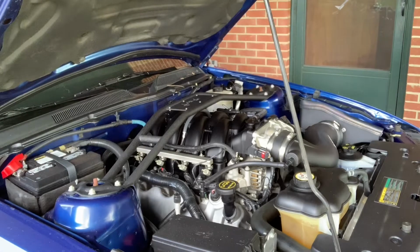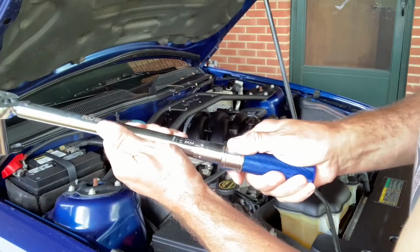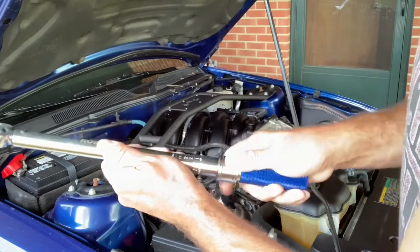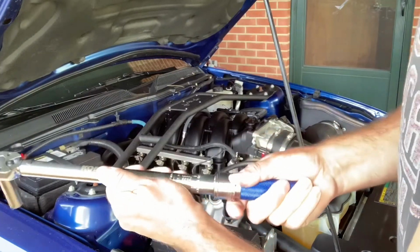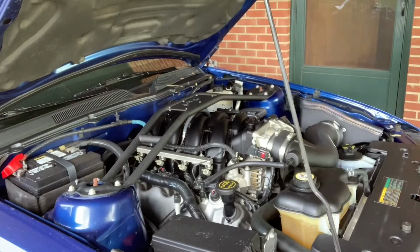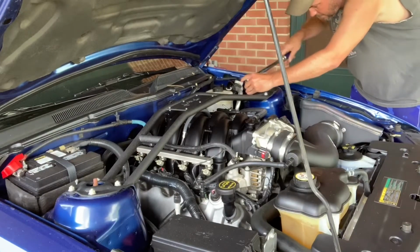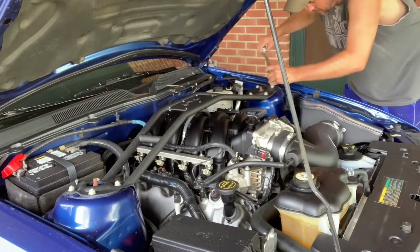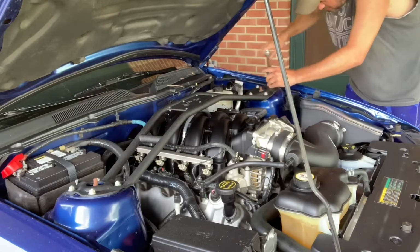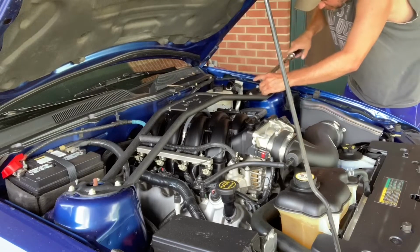So it does start at 20 foot-pounds. So you just pull this dial down. There's 21, 3, 4, 5, and 6. I may go up just to 7 just to make sure that it all does right. You heard it click right there. This is a clicker wrench.